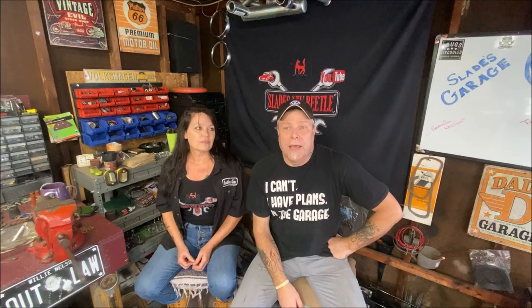Today I have my lovely assistant. They're going to help me out. We're going to take the front beam that you'd seen me remove three videos ago, and we're going to go ahead and disassemble it. We're going to pull the arms off the sides, remove the steering box, take the torsion leaves out. I call them torsion leaves. And strip it down to bareness. I may weld new plates on this one, and I may not. I may just get a new whole beam, and I'll explain it during the process why. So let's go ahead and start getting this done.